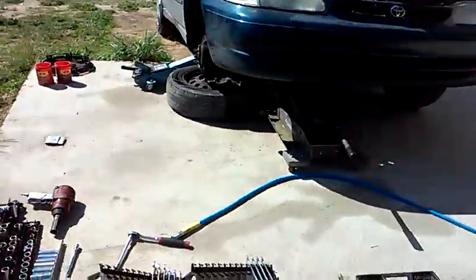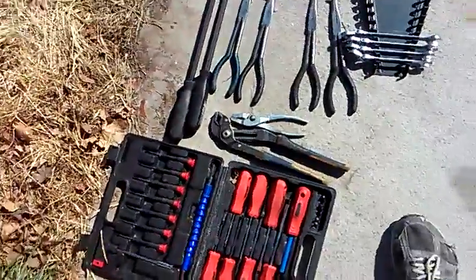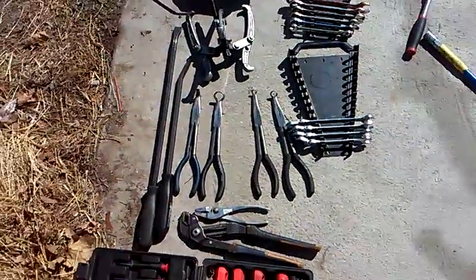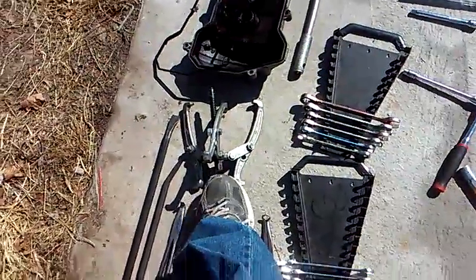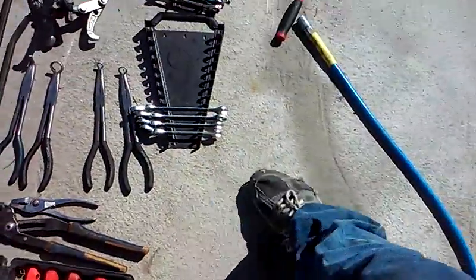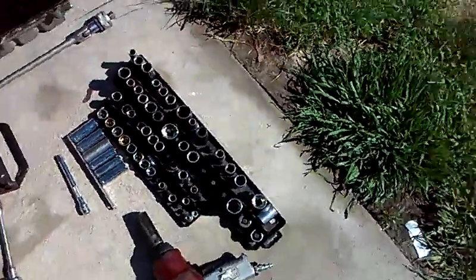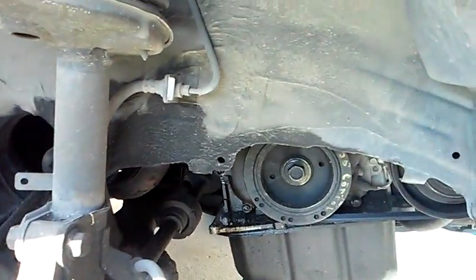To get this job done, as you can see, I have a good set of screwdrivers, a couple of pliers, channel locks, and hose pliers — those are going to make your job a lot easier. Also a long set of needle nose and angled needle nose as well. You're going to want a pulley puller of some type to pull your harmonic balancer. I've got a couple sets of ratcheting wrenches, sizes 10 to 17 millimeter, and a various assortment of sockets. I'm also using air to get my harmonic balancer bolt out.